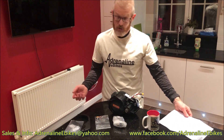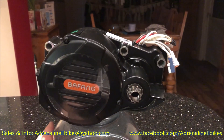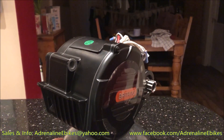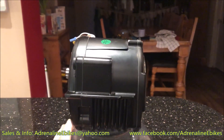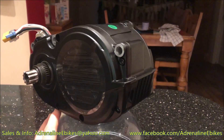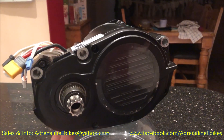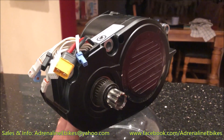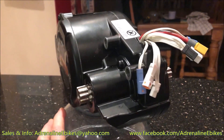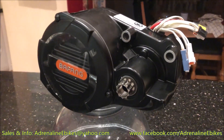Here's the motor in a bit more of a close-up. It comes with CAN bus support for the display and Shimano Di2 integration. It's programmable via an iPhone or Android app on the go, but it's not possible to program it with the original Bafang config tool. It allows for automatic shifting support based on pedal cadence, which makes it more sympathetic on the drive chain and sprockets. It also provides traction control, launch control, and wheelie control — generally far better sensitivity and response.